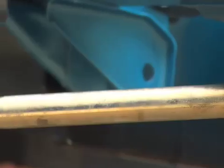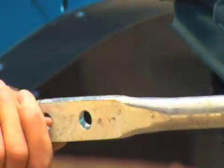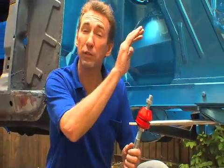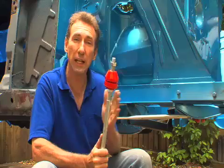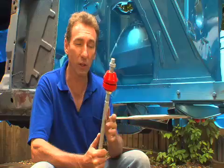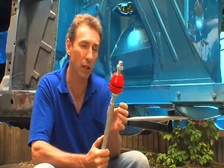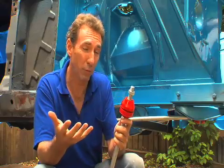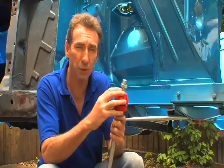Take the front strut rod and you'll notice there's a slight angle where the rod meets the lower control arm. There is a small indicator stamped into it that denotes the down position. Now, one important point: that's why we're replacing the whole front end rather than just replacing the old upper control arm and spring with a coil over shock — and that's the RRS front strut rod. It's heat treated steel so it's much stronger, fully adjustable, and the fairly rigid urethane bushes maintain steering geometry much more accurately. So this really is a high performance piece.